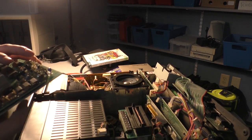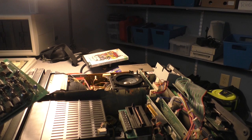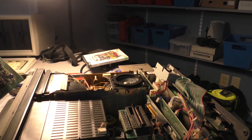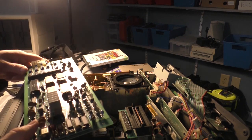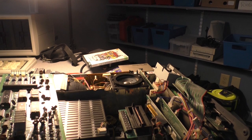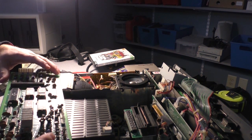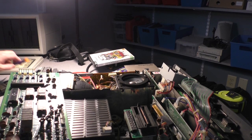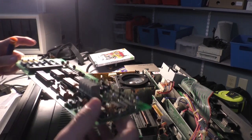All we got to do is find the old chip and pull it out. Now, if I'm not mistaken, it's going to be on this guy right here. So let me confirm which chip I'm looking for, and we'll yank it out and put this new guy in there. Alright, 906114-01 is the PLA chip that we're yanking, and it's right here on this CPU board.